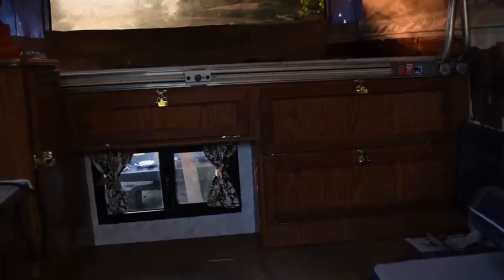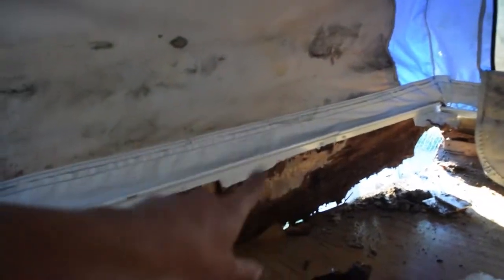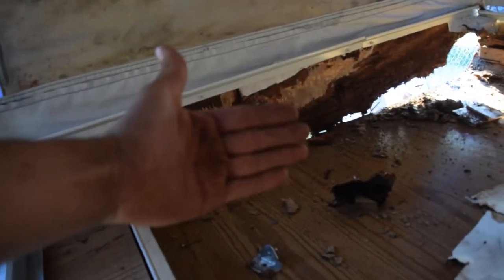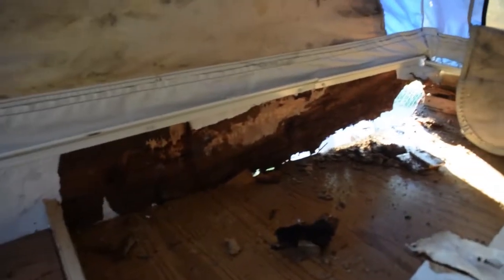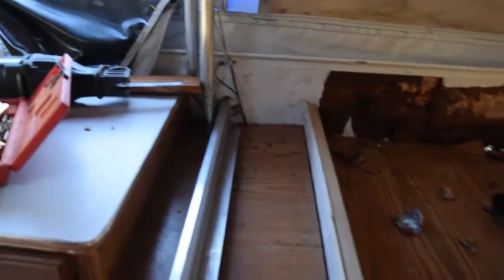So, yeah, you can see the inside here. This piece is what the bed sat on. And you can see, this is the exact piece that is actually the floor of the camper. You can see the hole there. It is insulated, so I think that contributes to why it's so rotted, because it's just veneer, and then the middle is foam, and then veneer on the other side. So it's really thin and kind of easy to get water into. So you can see this whole front part's going to need to be rebuilt. Shouldn't be that difficult, but starting from scratch is not ideal.